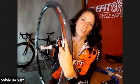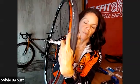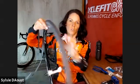And the rim tape has shifted. So these very, very sharp divots can basically slice your tire as well. So when you change your tire, always take a look. Is everything cool on the inside? And what I've done in a pinch for a mountain bike tire is I took electrical tape and I just taped the inside twice, and it's good. I just covered them up.